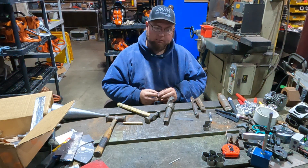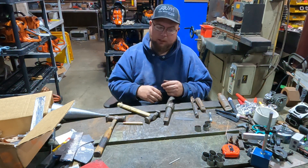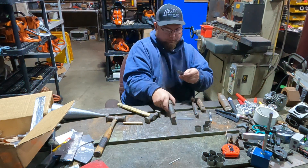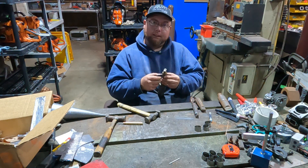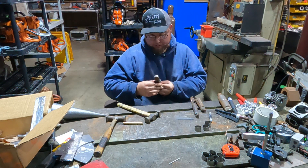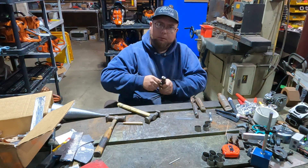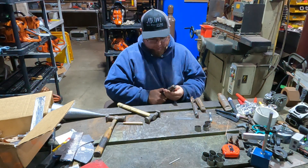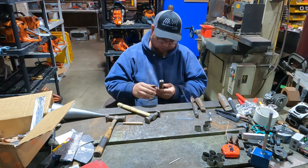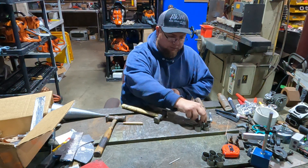My plan with this pipe is to spin these hard. I designed this pipe to hit in the 14 to 15 thousand RPM range, and we're going to set our ports to do the same. We're not doing any machine work on the chamber, so there won't be an awful lot of compression — hopefully that'll help hold the rod together. We'll just let it sing.